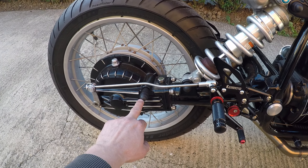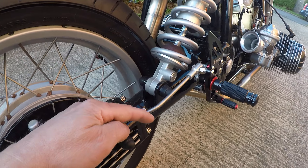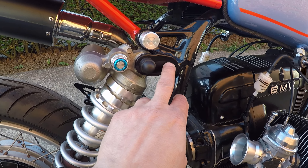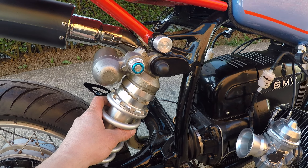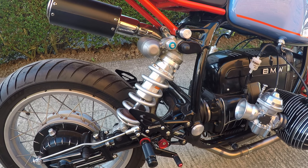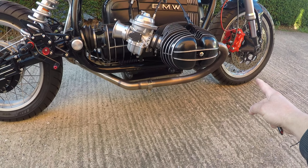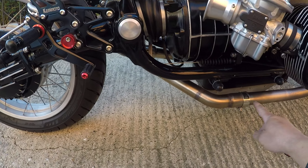The shock absorbers are from a Yamaha. I made a special box here under the original shock absorber mount for the RT. I fabricated strong brackets to hold the Yamaha R1 suspension, and this is all welded all the way around. You can exchange it with any other original or aftermarket Yamaha shock absorber — fully adjustable, of course.